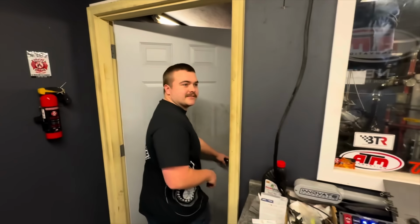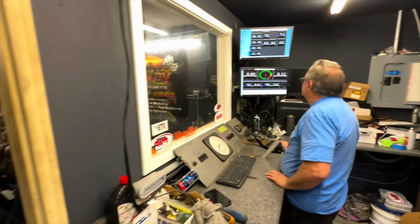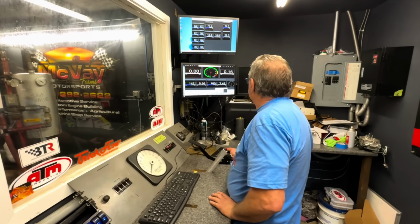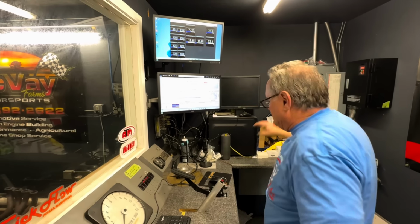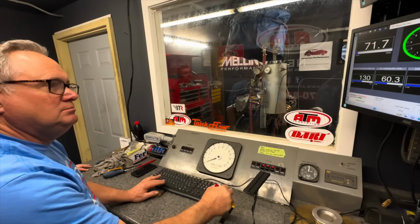So we lost 1 horsepower putting 2 degrees in it. So we know we're at the limit. That's about all there is left in the little guy. I was really trying to hit 450 horsepower, but decided to back the timing off 4 degrees to 36 and try to make one more pull in an attempt to crack 450 horsepower.